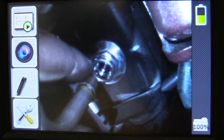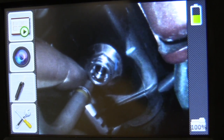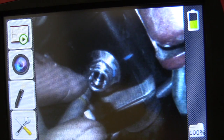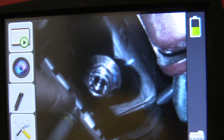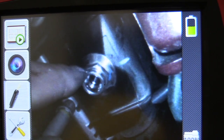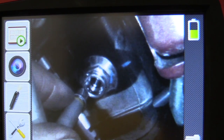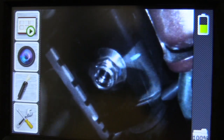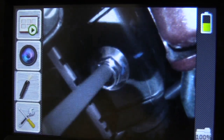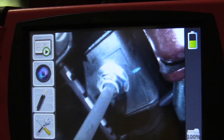The snout of this cooler tube is 3/8ths of an inch OD, and you can get 3/8ths OD poly tubing from Menards, Lowe's, or Home Depot. Inside this fitting there's an O-ring that seals on the snout of the cooler line. When you go back together, the snap ring is right there — push it in, it's ramped, and once you get beyond that ramp it clicks over the end and holds it in. We'll bring in that 3/8ths poly line, push it straight in, and that O-ring will seal right on it. Now the tube is out and we're ready to continue with the flush.